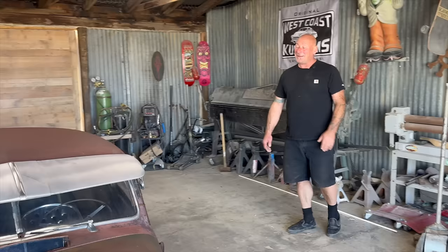There's some gas in the tank, so I'm going to try to make as little sparks as possible for the first part of this. I'm going to leave the top of the windshield intact, because we may chop the top more on this. I don't remember how much we chopped it, but see, here's the seam through the windshield. And this is just, again, movie magic. That's just plastic. I'm going to make a few marks from the inside. There is a structure inside here that the sun visors bolt to, and it's a structural piece. So I'm going to leave all that. You'll see it better once I cut off, but I'm going to mark it by drilling in and up. So we'll have three or more holes that we could trace lines across from.